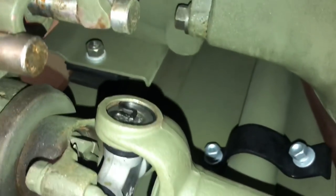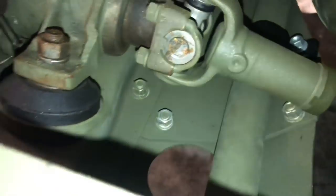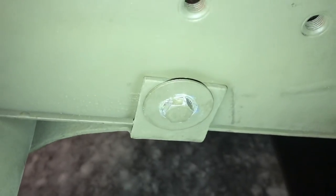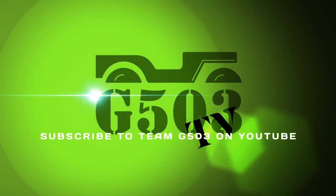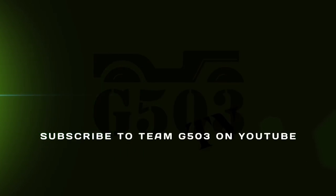It was quite easy to reinstall the fasteners onto the two-piece skid plate. There's a YouTube video on the Team G503 channel that shows exactly how to do that. I've got the outside bolt and washer back on the frame, and I can go back after all adjustments are done and touch up the paint. The next step is to add the muffler, which fastens to the tub of the Jeep, so we'll have to rig something up so we can drive it. Thank you for watching — subscribe to Team G503 on YouTube for more videos on the 1943 Willys MB restoration.